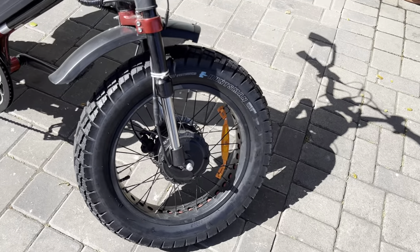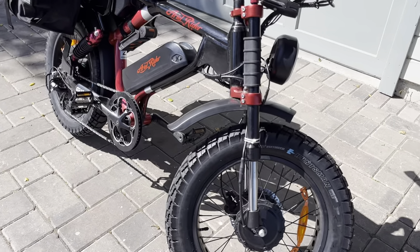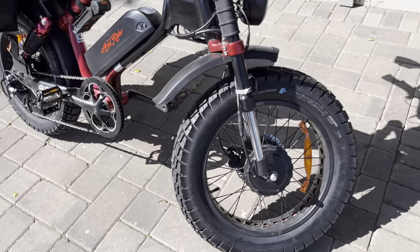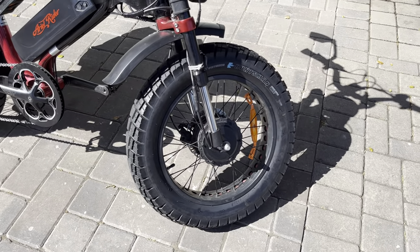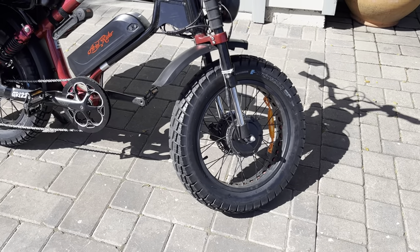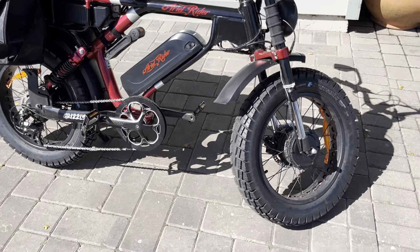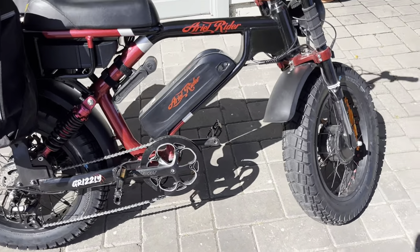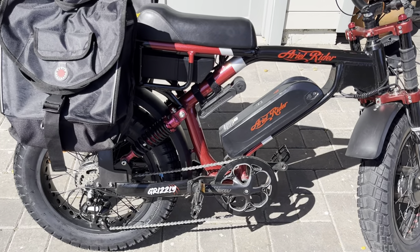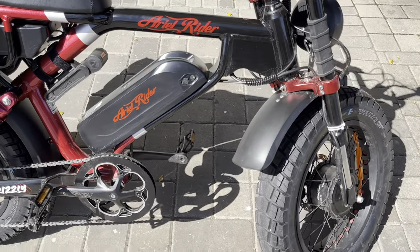One issue — there are two major things I'd like to change about this bike. One is that if you're under about 7 or 8 miles an hour and you have both hub motors engaged, the front wheel will spin out. Even if you're a heavier rider — a gentleman wrote in to my first video and said he weighs 220 pounds and it spins out for him at low speed. That means the rubber wears out much more quickly. I really tried to avoid it, but my front tire wore out more than my rear.